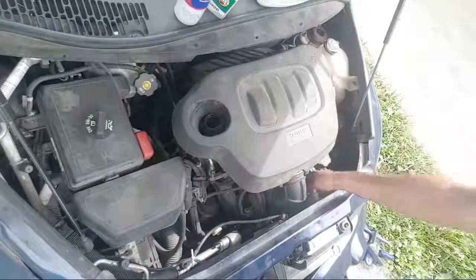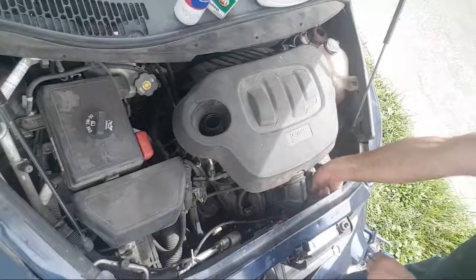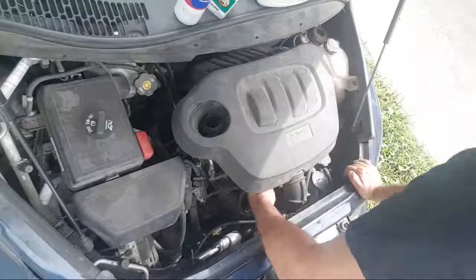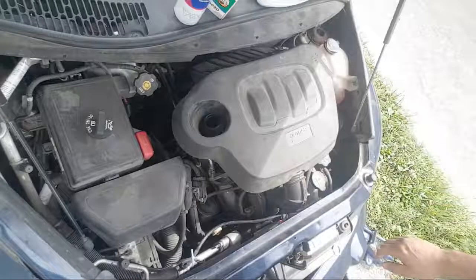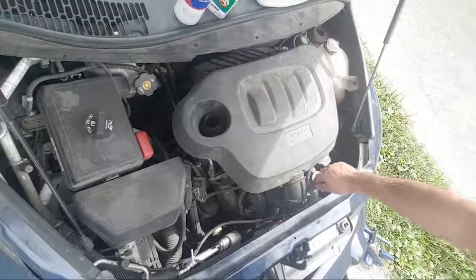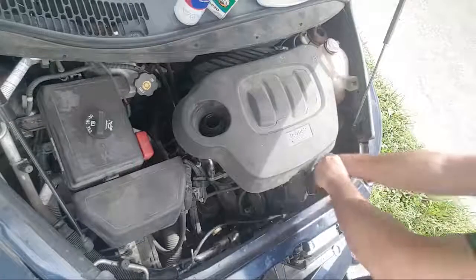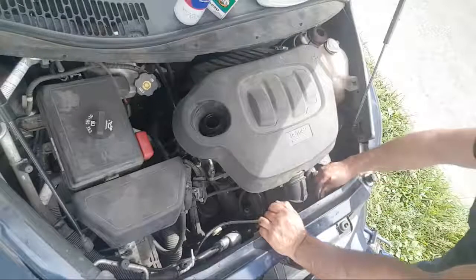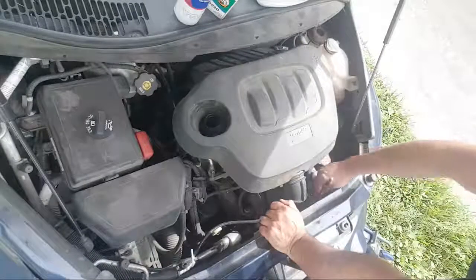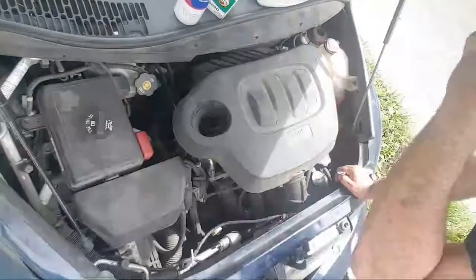I'm more than willing to bet that this vacuum leak is coming from off of this overflow line. There's this little tiny thing that connects into the throttle body hose, and the problem that I keep running into is this part here. You should be able to see it. Right here there's a little elbow that goes in, but it looks like the gasket's busted. Because what I'm getting is, when I throw her to 60 and put cruise control on, you can watch the RPMs fluctuate by 500 RPM constantly. So it's obviously a leak somewhere.